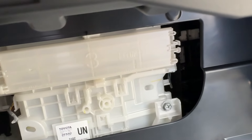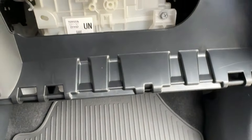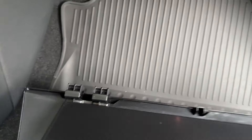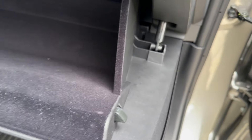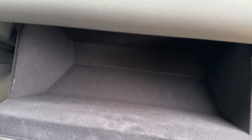Pretty much you've replaced the pollen filter. Now you need to put the glove compartment back together — it's very simple. Notice the left and right sides have hinges you want to match up. Once you align the hinges, push the glove compartment in an upward direction. Make sure it's aligned and in there. Slide the end pieces in, and put the damper hook back in. Test it out once or twice to make sure the glove compartment doesn't fall off. If everything's aligned, it should not fall off — if not, take it out and redo it.